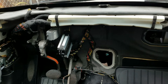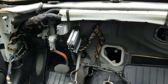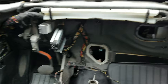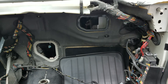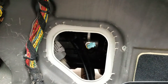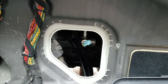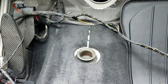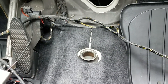As you can see, if this is a job you're willing to take on, this is what you're going to end up with — it's going to look like you're parting out your car because all this stuff has to come out. Right there you can see the line — that's your air conditioning line. I've got the heater hoses pushed up inside of there, and right there that's the drain for the evaporator for the condensation.